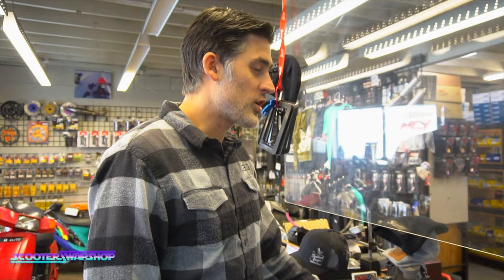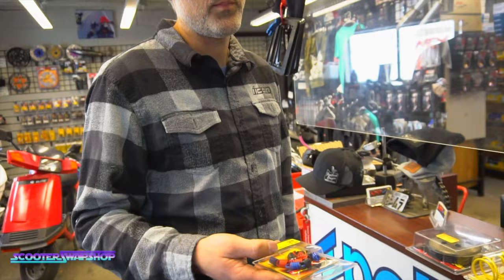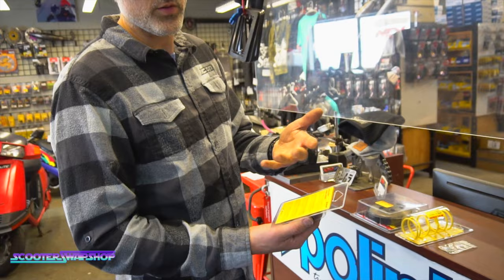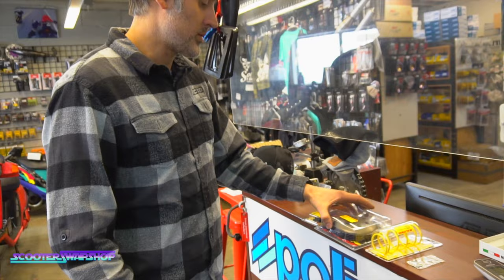Yeah, so if you call and say, oh, I bought a kit on eBay, they're red springs or yellow, I'm going to say, mm-hmm, I don't know. Do you have a Yamaha and you put in yellow springs for a Dio that are too long or whatever? So Malossi, I have probably 5 different red Malossis here in stock that are all different lengths and widths and everything. Inside this little packet it says what the strength is and everything. Malossi provides this, it folds out and gives you all your sizes and all the part numbers. But yeah, good point. What you order online or whatever doesn't really mean anything unless you have some documentation to go with it. And then we're going to set them up with the Malossi wing bell here.